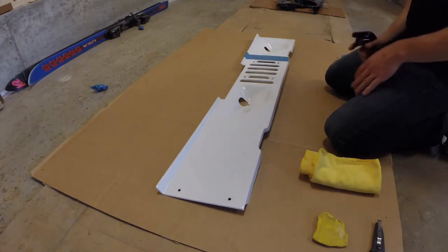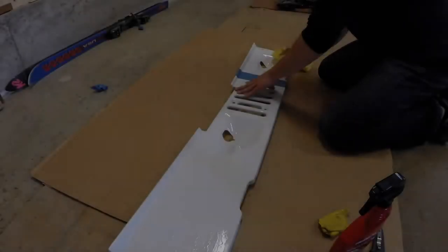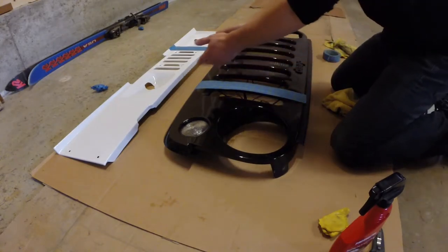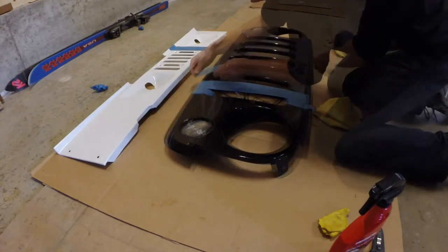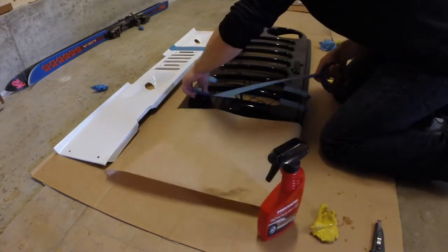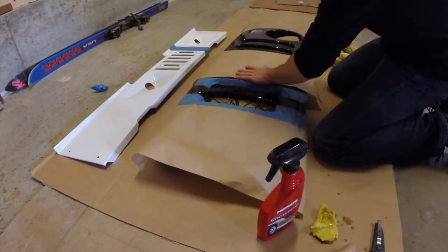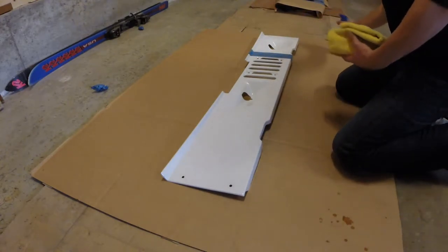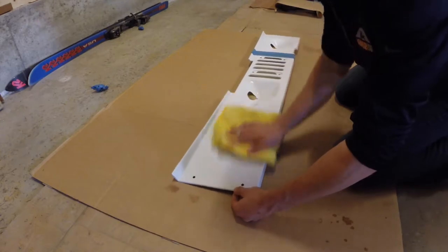What I'm going to do now is clay bar this guy — it's already been wiped down. With this piece I'm going to be actually painting it white, so I have to tape on either side of what I already have existing. Then I'm going to spray down with isopropyl alcohol, just a nice light coat, to take any contamination or oils from me touching it off so I don't have anything that creates an imperfection on the paint once we're done.